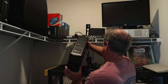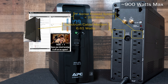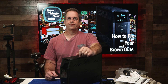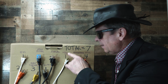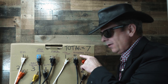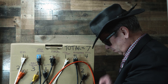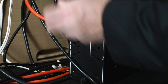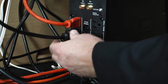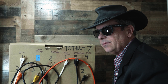Somewhere in the closet where most of the networking stuff sits is where we're going to install this. I'm going to use it for keeping the PFSense firewall running, the cable modem, the switch, one of the Wi-Fi routers, and maybe my main PC. Looking at the total load I can put into this battery backup, with the firewall at 2, the cable modem and other gear totaling around 5, that works out to about 7 — that's the most I can run on the battery backup side.